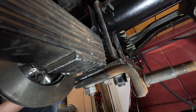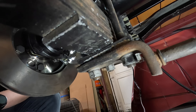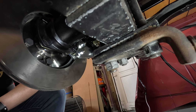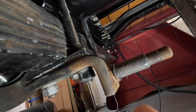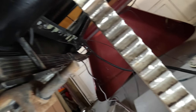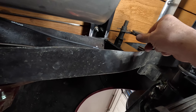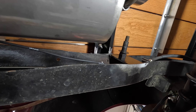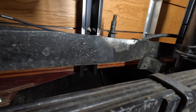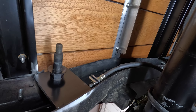I'm thinking 6 to 7 inches of total travel on the shocks, with a 14-inch center-to-center. The lower shock pin is 5/8 for the bushing on the lower shock. The upper shock — let me get that dimension — looks like 0.687, that's 11/16. So the top pin is 11/16 pin diameter.